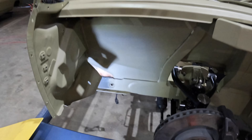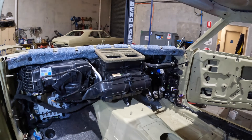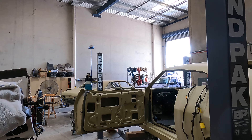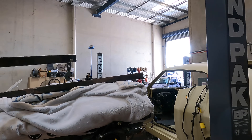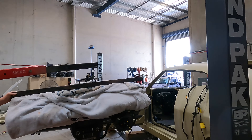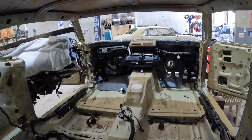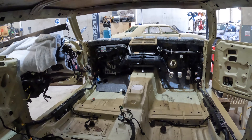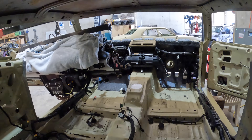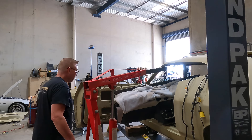So all in all it's some pretty major progress on the loom. The next thing I want to do is go ahead and install the dashboard, get that all plugged up and just make sure that our wiring loom is following the right path. The best way for me to get this dash in since I'm on my own — it is quite heavy — is to use the engine hoist. It's a matter of getting it in through the gap and then using the hoist to either come up or down to allow the boom arm to fit in underneath the roof line. It's going to be done in two stages: first get it inside the car, then we'll disconnect it, swap positions, and put the boom arm through the actual windscreen opening.